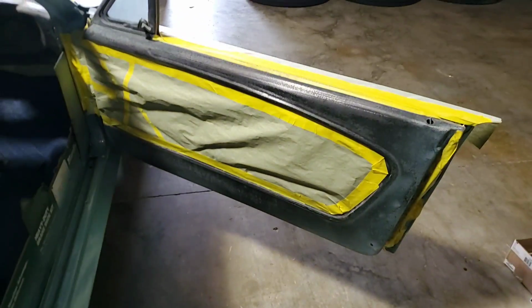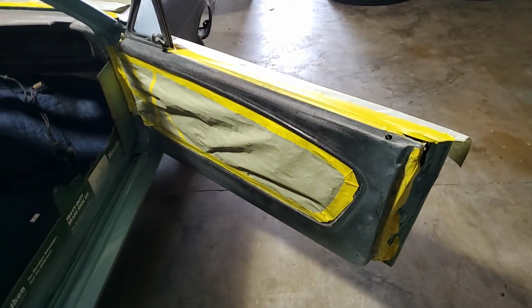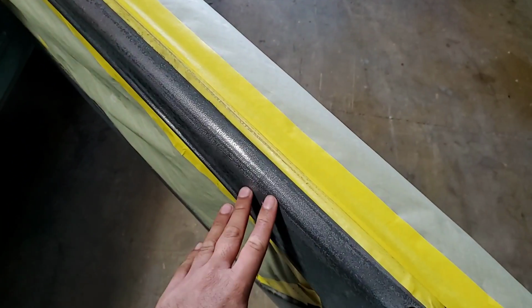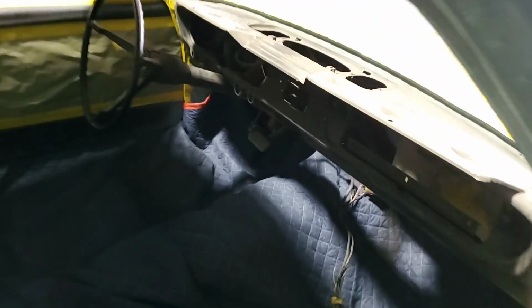And next step is going to be to paint the dash and the doors. That's going to be all black, according to the original specs. So we've got it sanded down with 320 grit, and the dash is all sanded down. The car's been jammed, and here's a closer look at the Tahoe turquoise color. It's kind of dusty because we've been sanding. But it's a nice color.